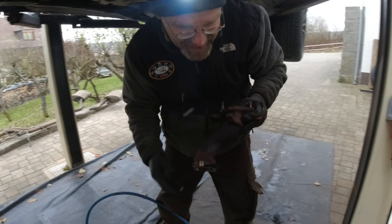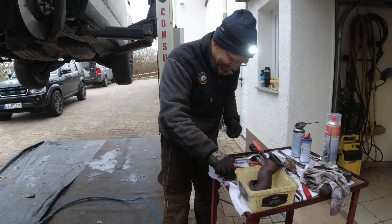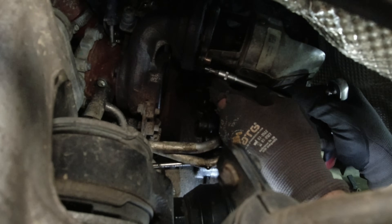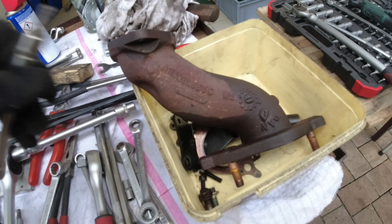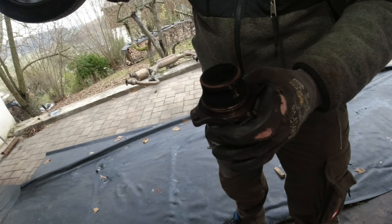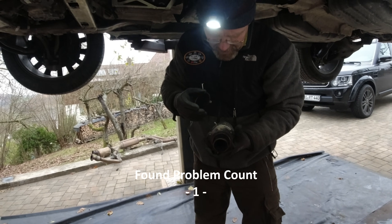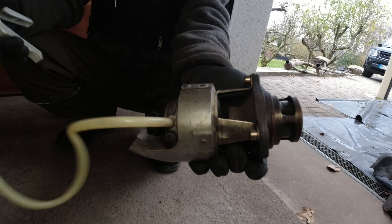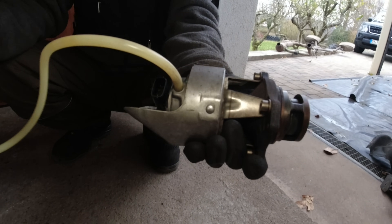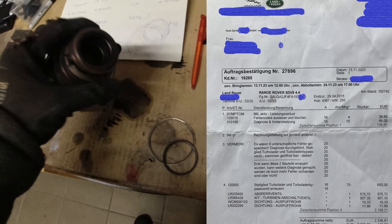So that piece took about an hour. We started after lunch with this. This bolt is really easy — it's like a Toyota. That is our piece of interest. I think this piece is not closing anymore properly, so the car leaks exhaust gases away from the first turbocharger. But actually it's working, it's not stuck, and I can also not see that it opens by accident. The Land Rover diagnosis was that this part is stuck, and it's not. So I'm going to put it back.